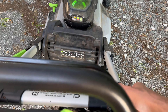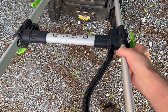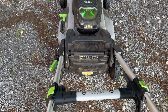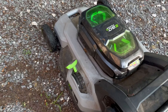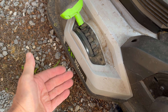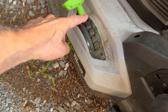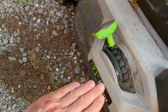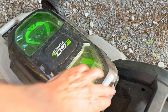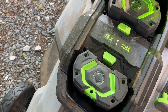So the first thing you do is you press this lever right here, then you unlatch here and here, pull it out to your desired length, and clip these back in like that. Then right over here you set the degree of how far you want it to go up or down — the level. I keep it all the way to like one. I like a real nice short lawn.